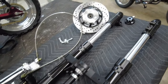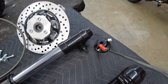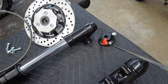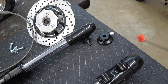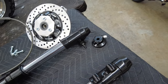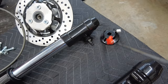The speedometer drive gear has a little notch in it — the previous version had that — but what it didn't have is a corresponding tab on the lower part of the fork to hold that notch and keep it from turning when the wheel was turning. The only thing keeping it from moving was your speedometer cable, which obviously was not ideal. I'm glad they put that tab on there, which goes into that notch and keeps that from spinning.